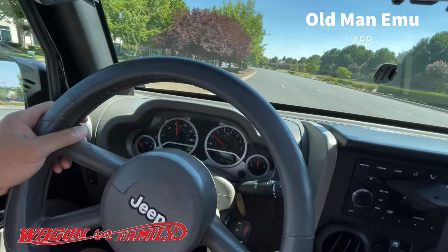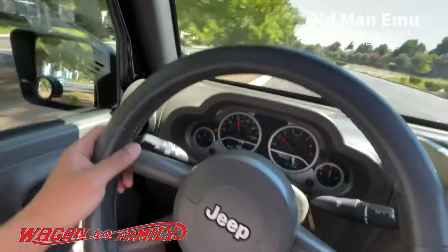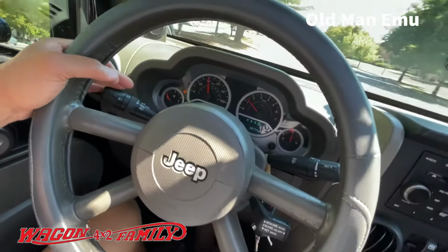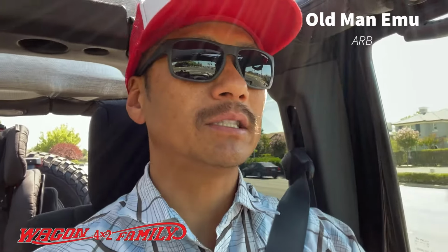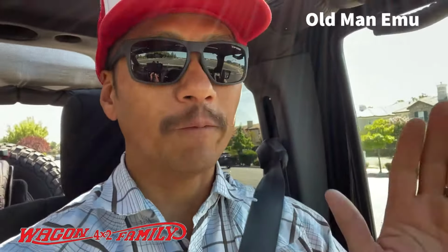Okay, so we're at 40, 42 miles an hour. There, shook a little bit. I don't know if you guys saw that. Let's go back and do that again. So I feel like that first pass, the dampening, the reaction of that shock is so slow. You can feel it like it wants to shake, but then it corrects it. And it shouldn't be that way.